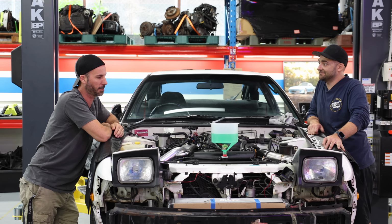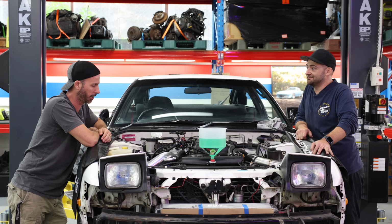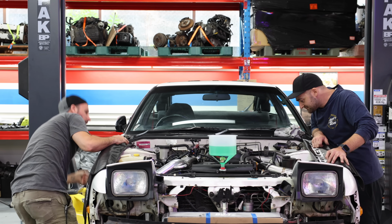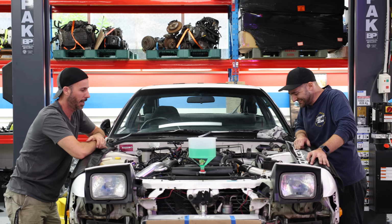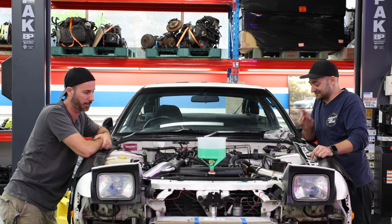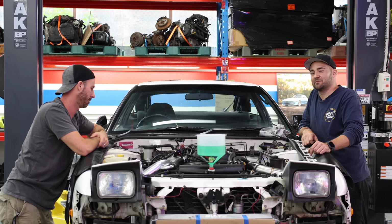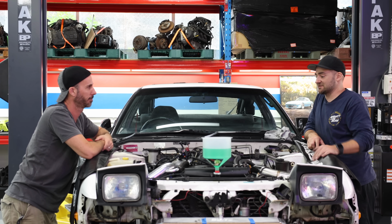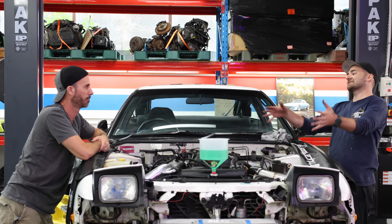It's screaming, making weird noises. Yep. It's leaking oil. It's leaking other stuff. I don't even know what else it's leaking down there, but there's colours of liquid that I don't even remember putting in the car. So there's a couple of little things to do. There's an empty power steering reservoir for some reason. There's an oil leak, but I'm pretty sure it's a turbo return because it looked a bit dodgy, but we'll get under there and have a look. But yeah, it starts, which is awesome, so it can move to its next stage.